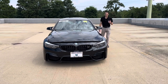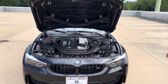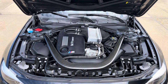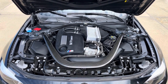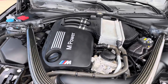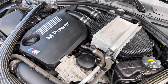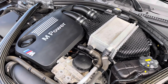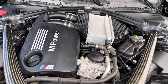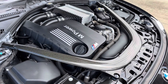In the F80 under the hood is BMW's S55 — a 3-liter twin-turbocharged inline-six. The S55 is based on the N55. What BMW does for their M engines is they take the series car engine, send it over to the M division, and they come back with a totally reworked and unique engine that's always more powerful and a little louder and angrier. The S55 makes 444 horsepower and just over 400 pound-feet of torque in competition trim — this is a Competition Pack car.